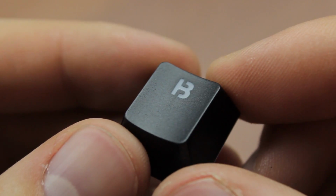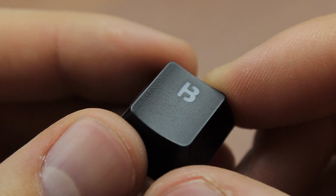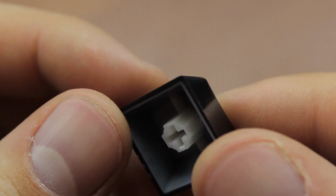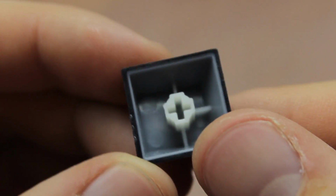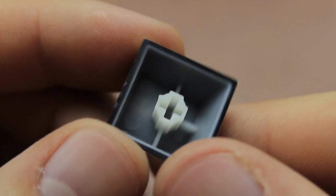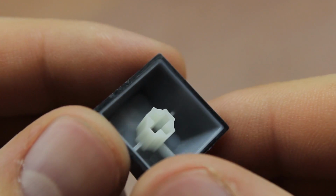I don't mind so much anyway, because some recent reports have shown that box switches use a mount that's ever so slightly wider than normal Cherry mount, and this has resulted in people's keycaps getting stretched, damaged, or even broken off. So I'm not going to use any expensive caps on this, although the caps that came with this keyboard don't seem visibly affected at least.